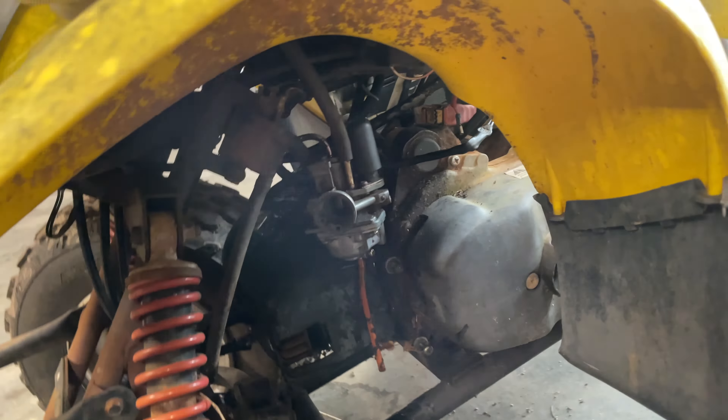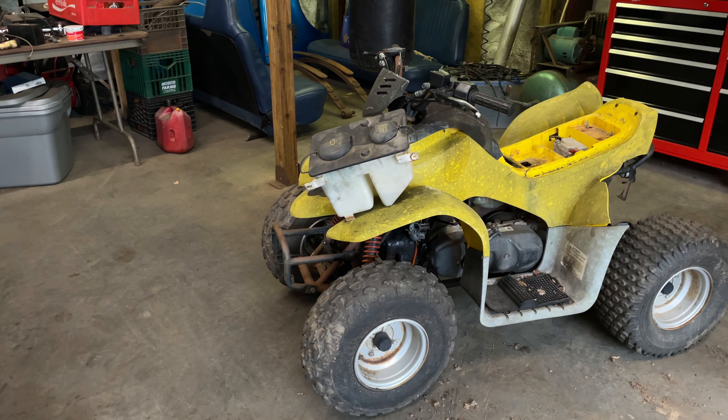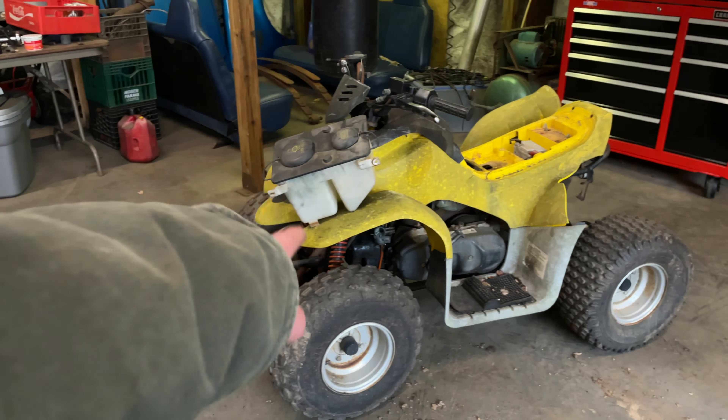So it's been a little while. Free quad is back — I aired up the tires, somehow got it to run, and I actually ripped it around the driveway a little bit, and then it just stopped running and I can't get it to pick up fuel now. I think the float got stuck all the way up, so now it's not letting any fuel in. We're gonna pull the carb off and try to rebuild that, and I'm still trying to get this one screw out of the air box.